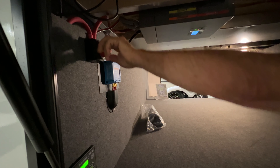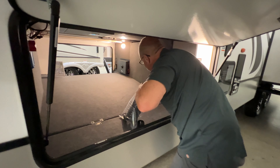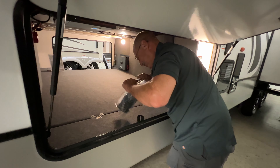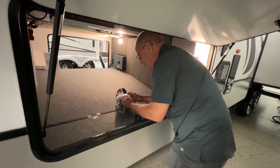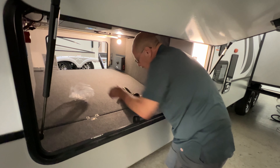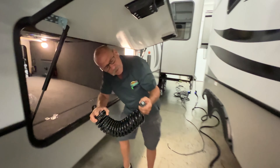Same thing with your rear jacks. If you're in a hole with those rear jacks and they're coming down, it's going to stroke out — it's not going to get there. So you have to get it up. Same way: just semi eyeball-level it all the way around. And like I said, if anything ever fails, just look right here and this is going to walk you right through everything.